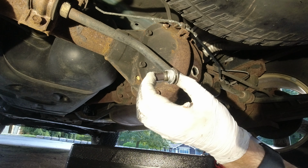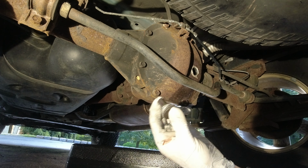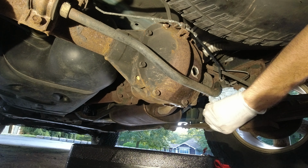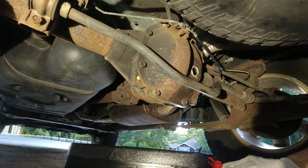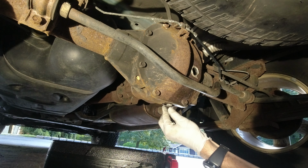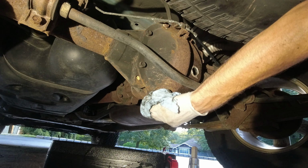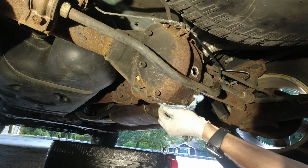we're gonna put the magnetic plug back in. I put some RTV gasket, and yeah, that should be good. Just wipe it off a little bit. This to the side, and let's screw this back in place. Alright, that should be perfect. That feels good. Wipe it off again. Nice. Now we can start filling it up with a new oil.